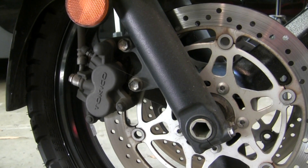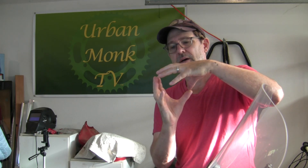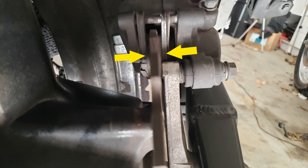There's a key difference in the mechanics. In drum brakes, you have a round object expanding or contracting around or within a drum. The geometry is such that it has to pull on one side with a fulcrum on the other side, so it wears unevenly and presses slightly unevenly against the drum. Disc brakes solve that problem — they press evenly against the rotating disc the same way all the way through the life of the pads.